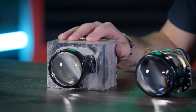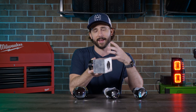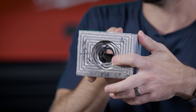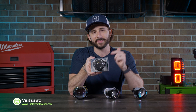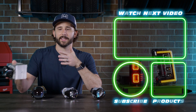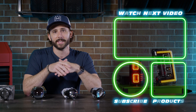You're probably wondering what this hunk of metal is. This is actually what a projector prototype looks like — literally a chunk of aluminum that's been CNC machined with the reflector bowl geometry right into the back of it. You have your lens, lens holder, cutoff shield, and straight-up CNC machined reflector bowls with a D2S holder in the back. This thing was actually produced back in 2017, but the guys at Morimoto said they didn't really know how it fit into the lineup — it's not a D2S 5.0, it's not a Mini H1. So it basically went on the shelf until you guys raised your hands and said you do want a Mini H1-sized projector with a D2S bulb, and here you have it.